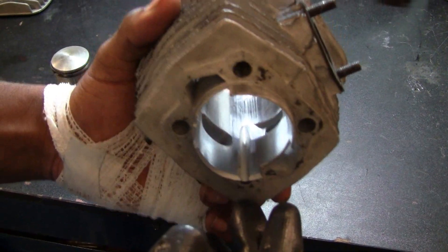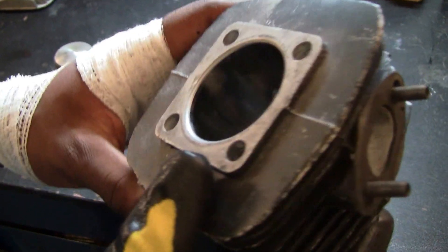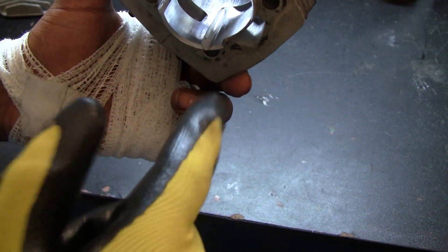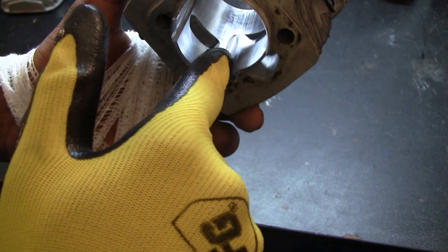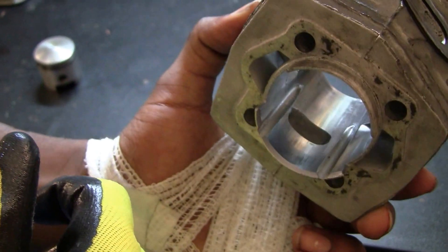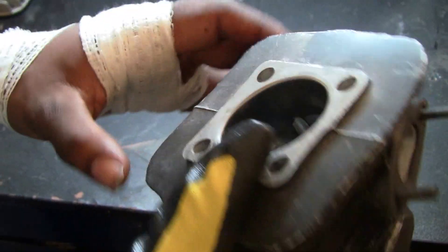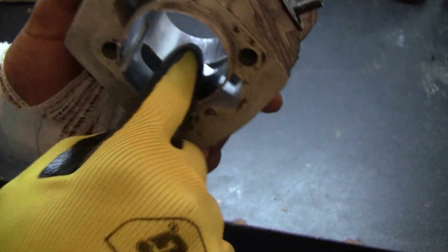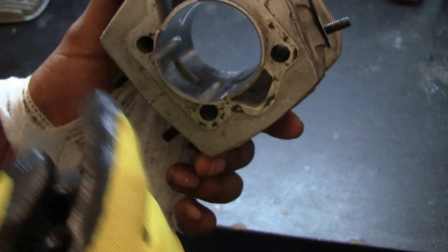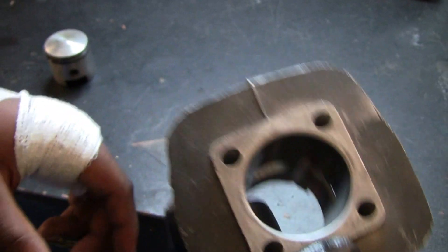Boost ports are a little tricky to make. I use a dremel tool with a conical shaping bit and just roll it up on both sides, trying to make them as equally spaced as possible. This is just a test cylinder for demonstration purposes — so before you try anything, be aware there are some imperfections in it. At this point it makes a fine paperweight at least.